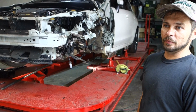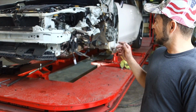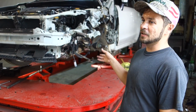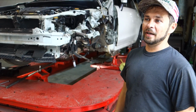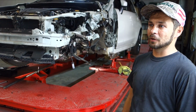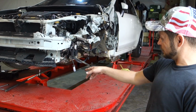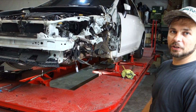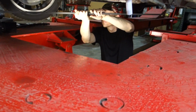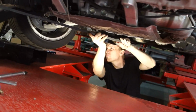We're just going to use our tram gauge because our system is kind of out of date and it doesn't have this new car on it. The Challenger, it had it on there, but the body hasn't changed since '08, so we were able to pull them from an older body. But this one's all new, and we don't have it, so we are just going to use the tram gauge and measure it out, make sure everything is straight, or if we need to make it straight.